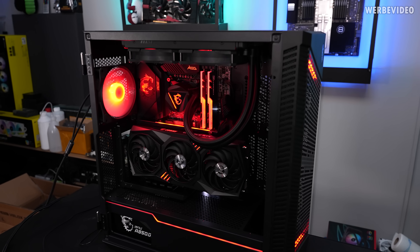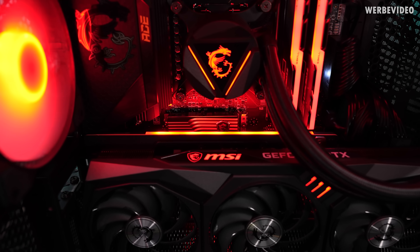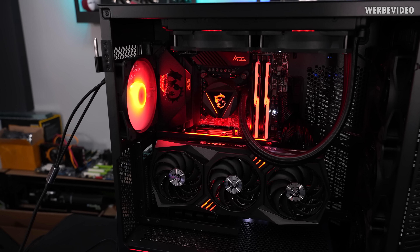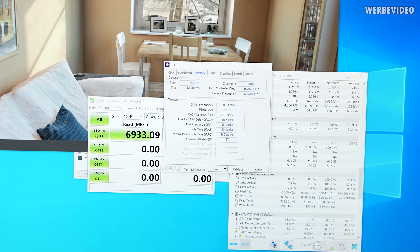The result turns out quite nicely. With the red color theme I think it looks very nice. The first thing I was thinking about after finishing the build is the airflow around the SSD, because it's sitting so closely squeezed behind the GPU — I was a bit worried about temperatures. The CPU itself was running stock, which was working fine. I kind of overestimated those memory sticks — interesting, because I had the same type before and they easily passed 3600 C16. These couldn't even do 3700 C16, only at C18 with very loose subtimings. So it's pure luck whether your sticks can run a bit higher. I went back down to 3200 C16, which was better than 3400 C18.